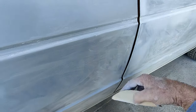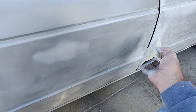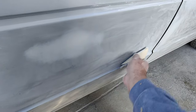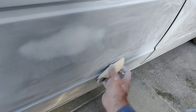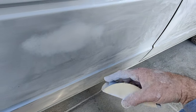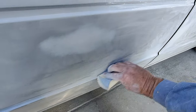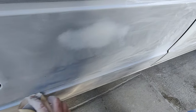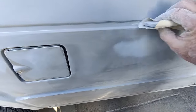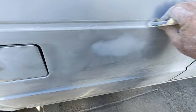You could use spray can epoxy prime. What I do is I'll tack rag the whole car and get everything ready for paint. Or you can do it a couple different ways. You can get it all ready, blow it off really good, and then go through and use that wet on wet, spray can everything, and then go around with a Scotch-Brite pad and a piece of really fine sandpaper, like 400 or whatever, maybe even finer, maybe 600, and just kind of scuff it down. There's a million ways to do this, okay? But I just do it and spray it. And it turns out really good.